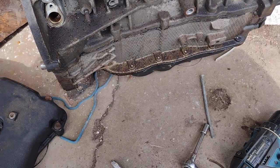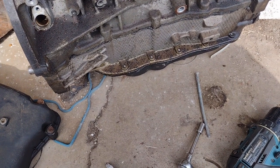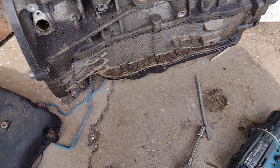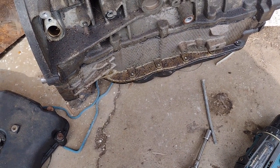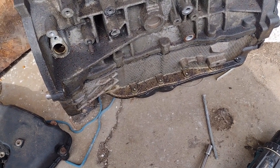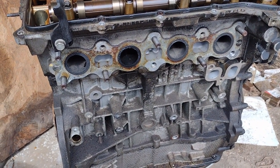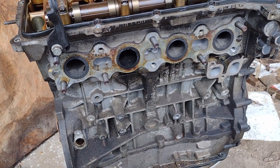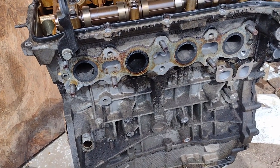Now, like I said, I know the bottom end's bad on this thing. I can get a brand new crankshaft for under $200. Probably pick up a used rod, or even the rod out of the donor car. So I have a good engine here. Korea is the motherland for these engines, and with rings that aren't low tension, they shouldn't use oil as much, and I should get this engine back on the road. I'm sure the cylinder walls are fine. Just put some rings in it and let her go another 100,000.